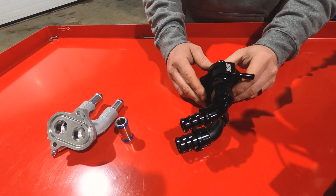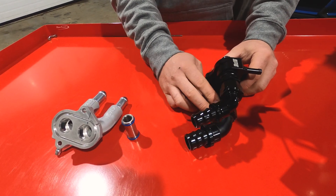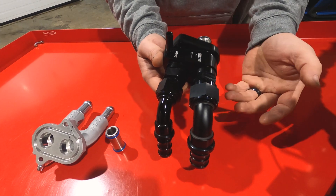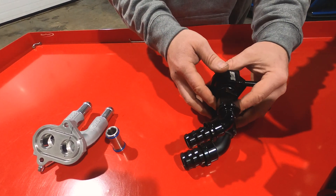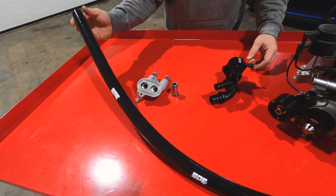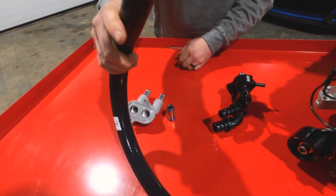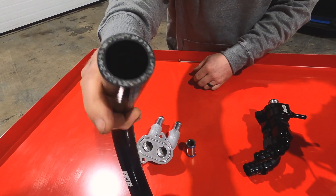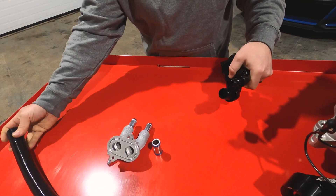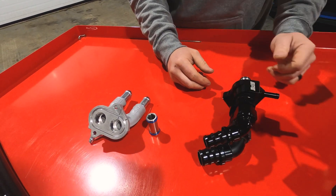Since you have a dash 16, you have the ability to use a dash 16 hose end and adapter — these are o-ringed ORB-style fittings, so they can technically be adapted to whatever you want, but the dash 16 adapter obviously needs larger hose. We're going to put a kit together for the customer: these will be available in five-foot sections of one-inch, five-ply silicone reinforced hose that fits the dash 16 fitting. The nice thing is these are all designed as push-lock style fittings, so you don't need any clamps — it's a very clean, finished look once you get it pressed on.